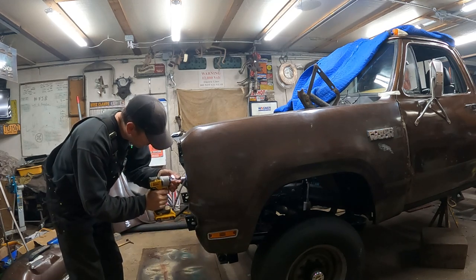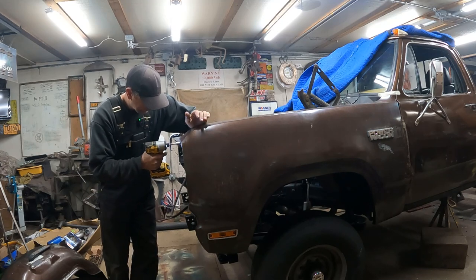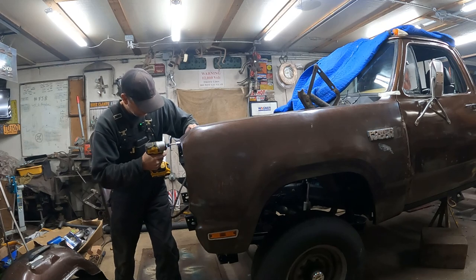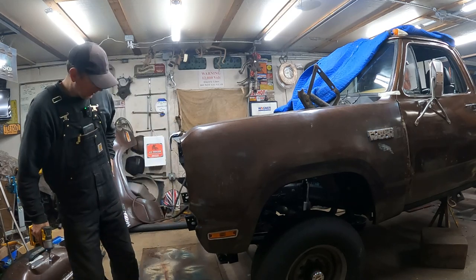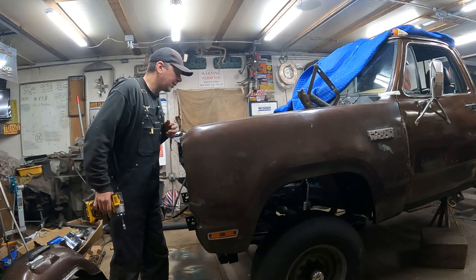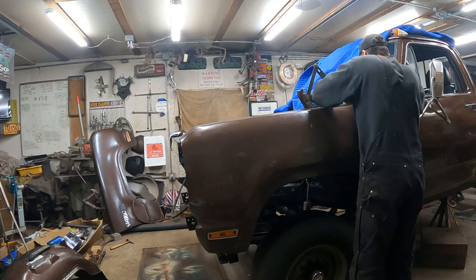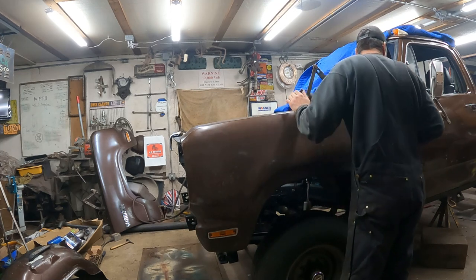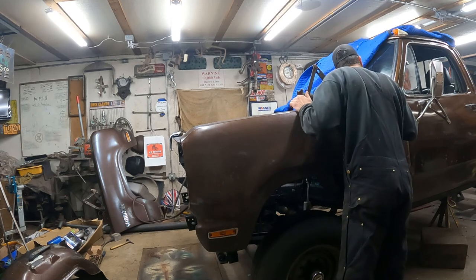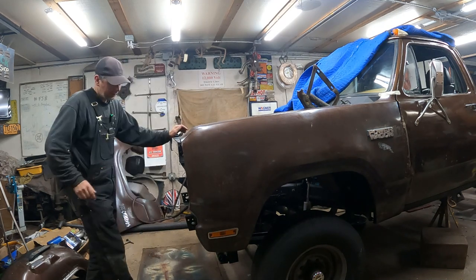That's about where it was — the paint mark is lined up perfect. Top of the fender is going to go out just a hair. Looks pretty good. I'm going to slide a couple of shims in. This has three; it looks like it needs maybe two or three. Ow — that's a finger pincher. We're in the ballpark. The top of the fender is pushed in. I've got to do some adjusting, but it's starting to line up.